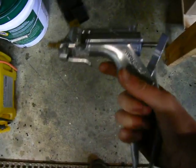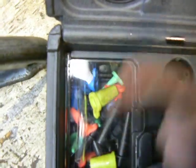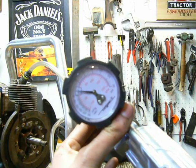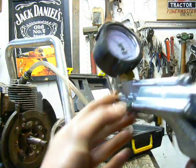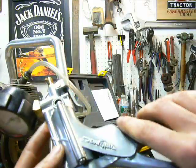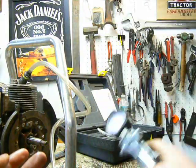All you do is just squeeze it like that to draw pressure or vacuum. The kit comes with some tubing, these adapter things, a bunch of plugs and nozzles and stuff. I'll just show you quickly how the pump works. I've got it on vacuum right now and I'll cover up the outlet with my finger — you'll see the needle go down that way, and I'll let go. Pop! I'll go back to zero. Turn it to pressure, and you can see it make pressure. Very nice unit. It's all smooth cast aluminum, it looks nice, feels good to hold, nice and hefty. You can even get rebuild kits for these if the O-rings wear out.